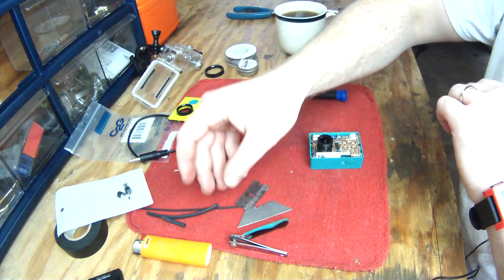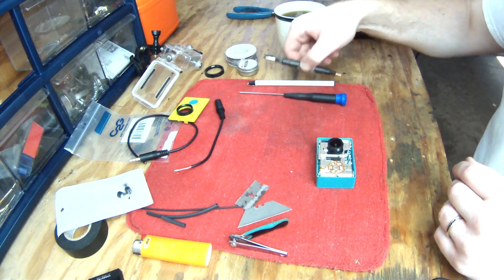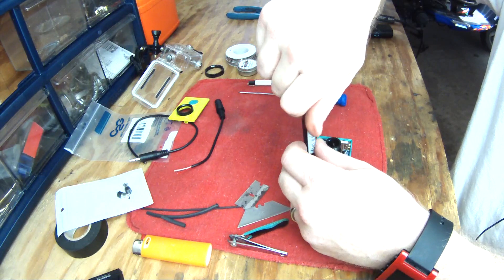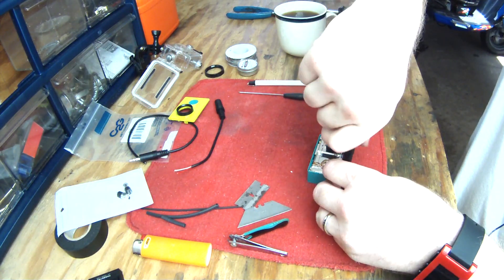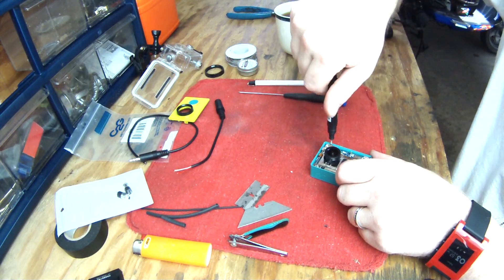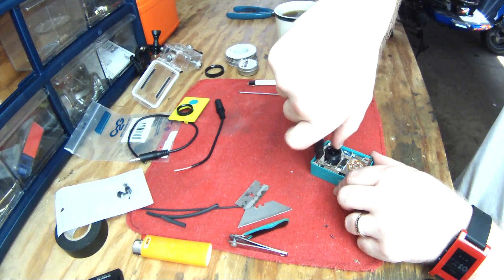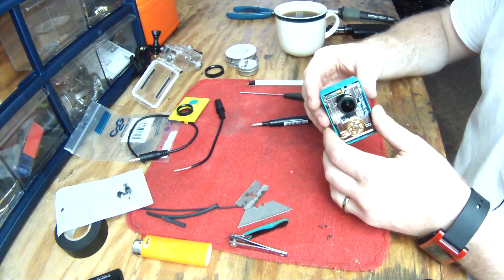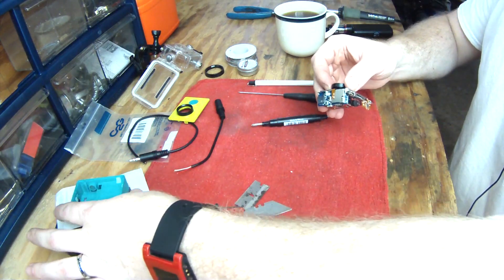Here's where it gets very sensitive. Make sure that you don't force anything from this point. I probably should remove the screws first. So you're going to need something like an eyeglass screwdriver — these are super cheap and most of them actually hold up well, so grab a couple and throw them in your kit. These screws are very small, so my standard screwdrivers were just too large. Don't try to do it with a larger screwdriver — you'll strip them pretty easily, and then you might have to delicately drill one out. This is in here pretty tightly, so I wouldn't worry if you lose a screw or had to drill one out.